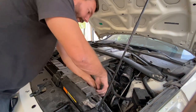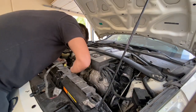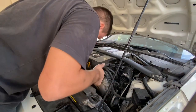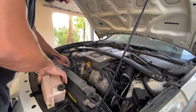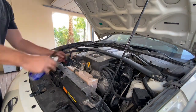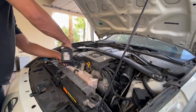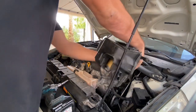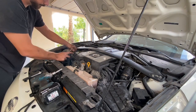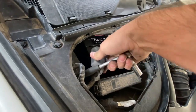We've got the two 10-millimeter bolts up here that hold the fan shroud in — tighten those, and a couple of plastic connectors that help with orientation. Perfect — that's connected and tightened. We've also got the coolant overflow tank back in. We've dropped back down, reconnected the battery, and now it's time to start her up and see if we're charging.